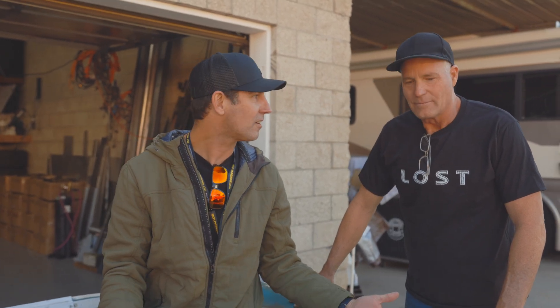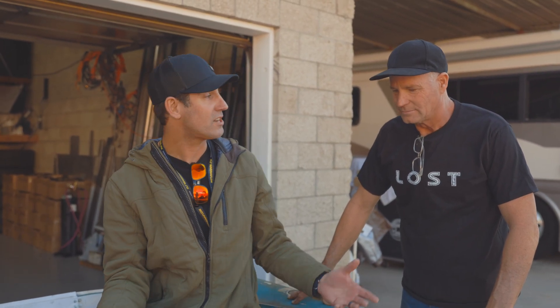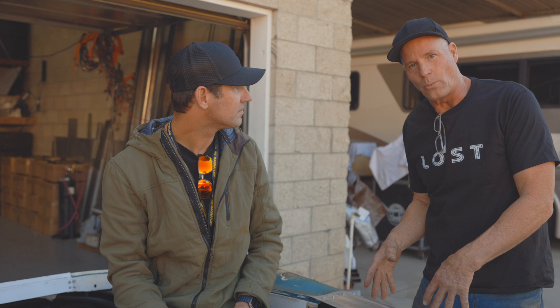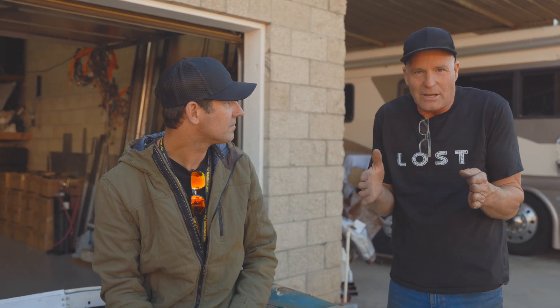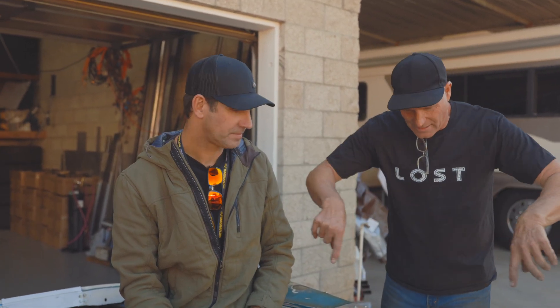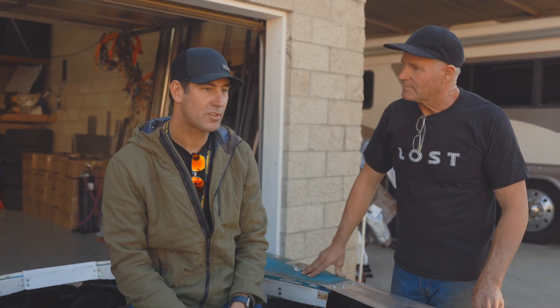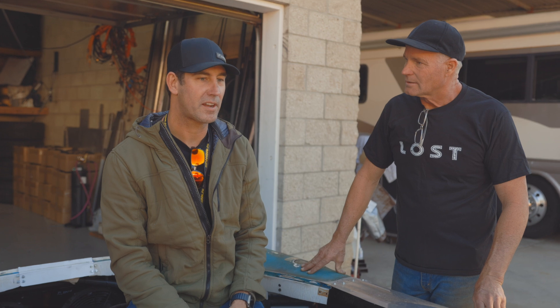It's funny — a neighbor came over and asked why I was making the body so long. I showed him a tire and said it almost fits next to the battery pack at a normal wheelbase, but you can only turn this much. So you've got to get it in front of the battery where there's a little divot so you can actually turn sharp in a parking lot. You want to be able to use the car. And length does give you stability, especially at higher speeds. You do not want to hit this thing sideways at high speed — that thing can kill you.